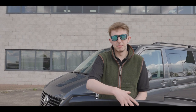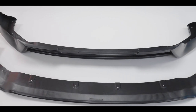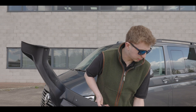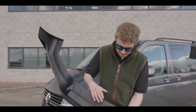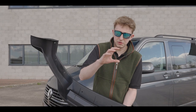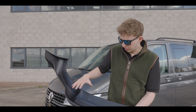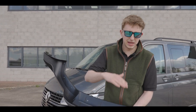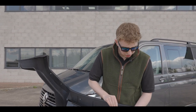We're going to start off with the chin part of the LVS kit. It's a two-part kit — we've got this chin which bonds onto the front of the van, and we've got a splitter which goes onto the bottom of this. We've put in strengthening beams in the gap, which is obviously seen on the front of the van. That's going to stop it from bowing when air goes through it, which is a really important feature of the chin — it'll keep everything nice and tight together.